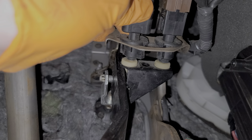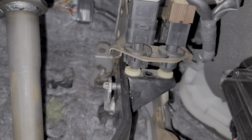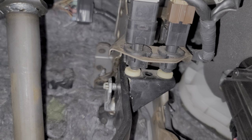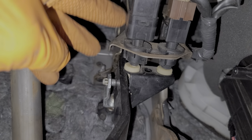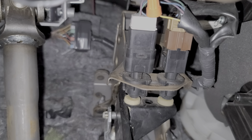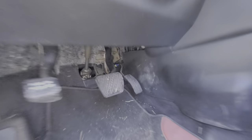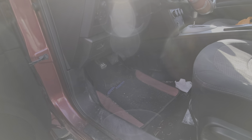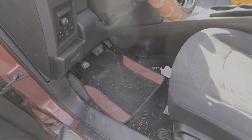Definitely something to check out. I like to back up to a building that has a glass exterior at night — that way I can look at the reflection of my brake lights without getting out of the car and fine-tune the position of the brake light switch. I hope that this information has been helpful, or at the very least a good starting point in troubleshooting the brake lights on your Nissan Rogue. If you have any questions, I'd like to hear about it down below. Please do chime in if you have any advice. Thanks for watching.